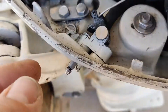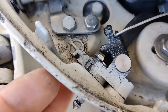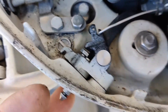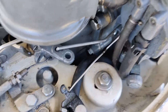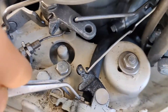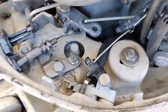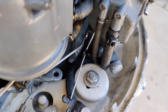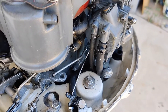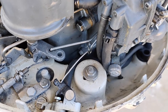On this motor, I have a missing part that pushes the entire system here. The only way to fix it — I got this little bolt over here, and this is the connector. When I connect it, you can see the main jet is open. When I disconnect, it will close the main jet right away and the engine will turn off.